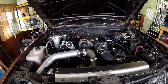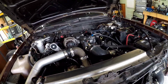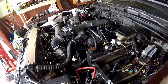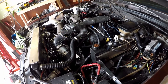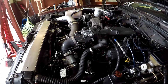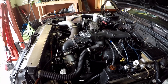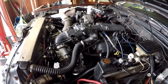She's almost ready to go. I've got some new oil in it and a new filter too — the bare necessities. There still isn't any coolant in here, because I'm kind of nervous about what I did with the cam timing. I retarded the cam timing a little bit in this car and I haven't really checked for piston to valve clearance. Hopefully they don't become too friendly, but if I have to tear the motor apart, I don't want to have to replace the oil again. I'll run it without coolant for a little bit just to see if it'll fire up. It does need a new tune for the new throttle body because it has a different mass airflow sensor, but for now it should at least just fire up. The tables are pretty close, so it shouldn't be a big deal. I've got all my hoses connected, all the electronics and sensors connected too, so I should be able to see if she fires up.